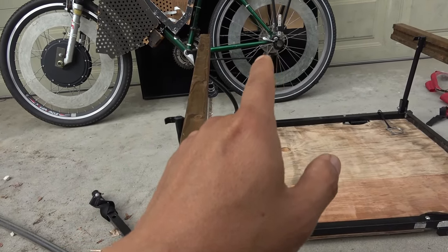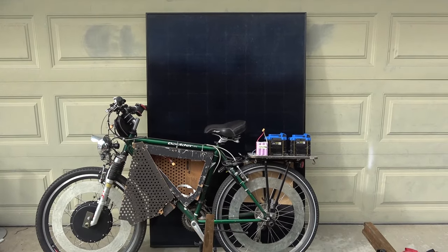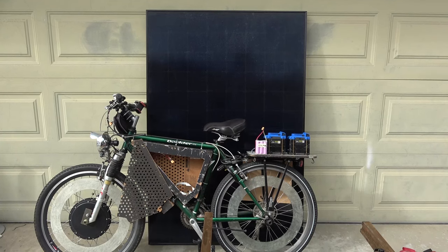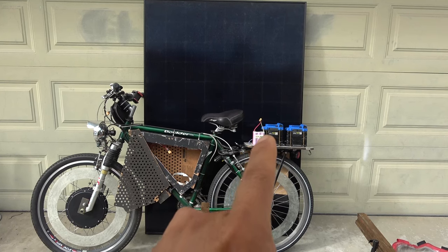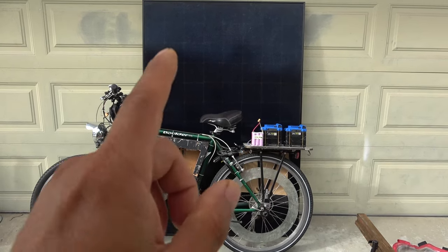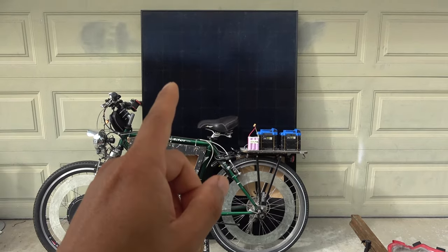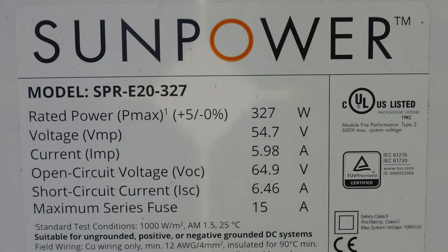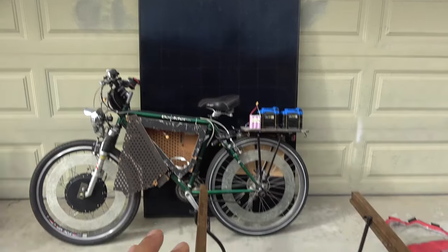This is going to be attached to the back of the bike, towing the solar panel behind. This solar panel puts out 63 volts open circuit when not under load. My battery pack is 15S and when fully charged it's coincidentally also 63 volts, so this solar panel is perfect to power this e-bike. Under load the panel outputs only about 55 volts, which is perfect for this e-bike — at least that's the theory. Let's hook it up and make sure it works before putting everything together.